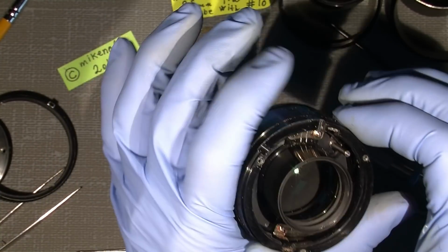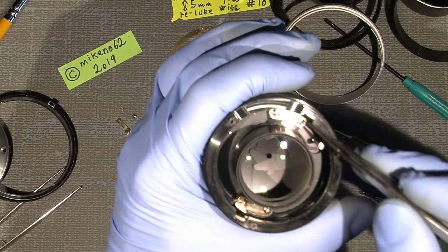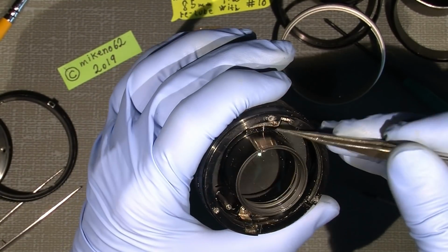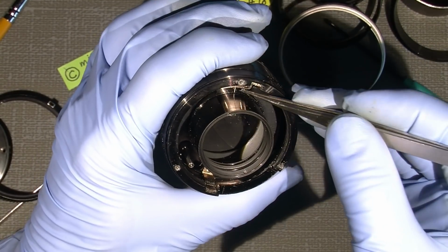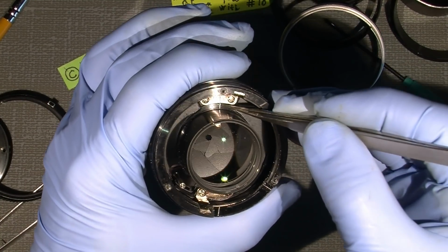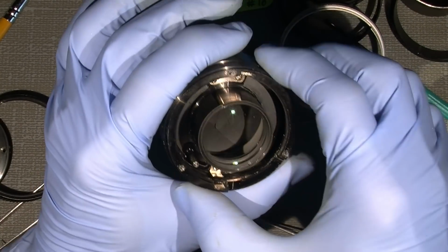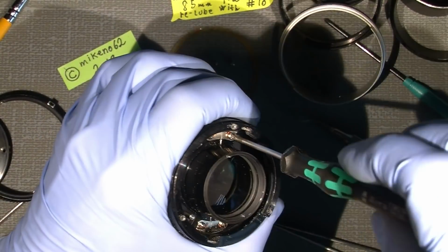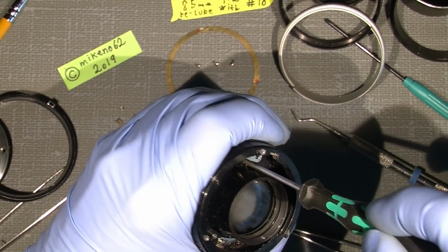Now, there are two guide pins in here, one on each side, here and there, and I set it with number 1, just to prevent it goes wrong when I assembled it. So I set a mark here, and also a 1 mark here and a 2 here. So nothing wrong will happen. So unscrew those. It's easily done.